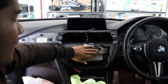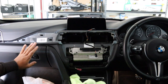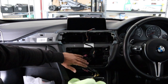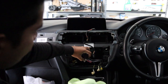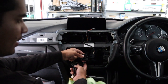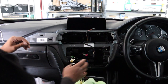Once that's out, this will expose the main radio module. You can see there's a fair bit of space down here, so you can look at mounting the module right in here, or you can remove the glove box and put it behind there. Radio module is free — take your time and make sure you don't lose any of these plugs. There are a lot of plugs: the quad lock, and this pink one right here is our screen connection — we'll be using that.